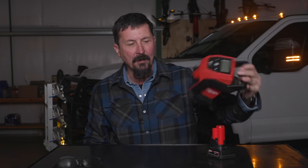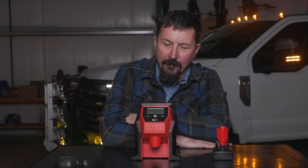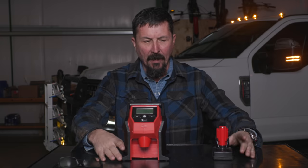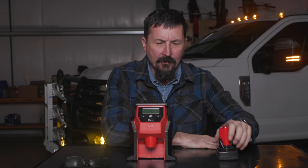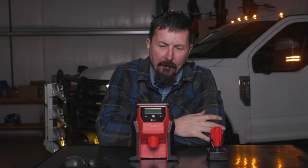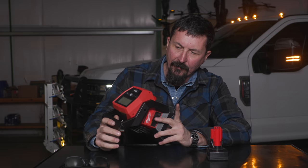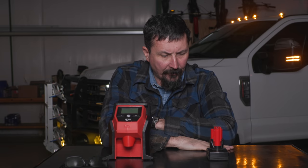You can do that same thing with a small compressor. So is it perfect? No, but up to 50 PSI it's adequate, and it seems to be well balanced — it didn't shake around much. It kind of stayed right where I put it, compared with the Slime which was really cheesy and bounced all around. I really like it. The price I paid — I think these are on promotion right now — was $119 or so, and that came with a charger and a smaller battery. I think it was like $120, and I thought that was really fair. I've never seen a little compact compressor that is built as nicely as this and has the ability to program and shut off by itself. I'd say that is a win.